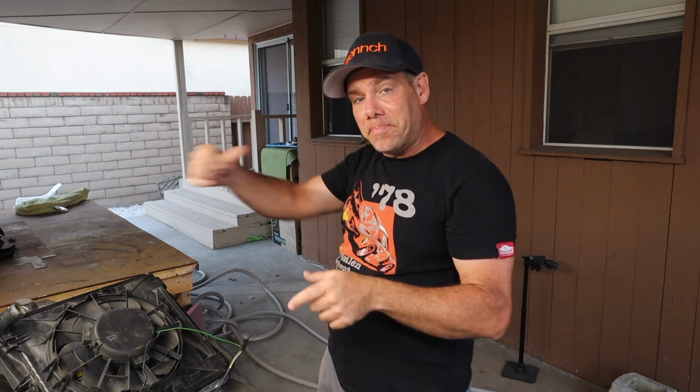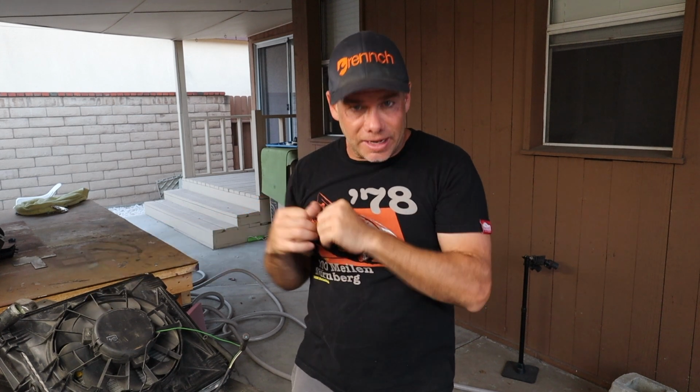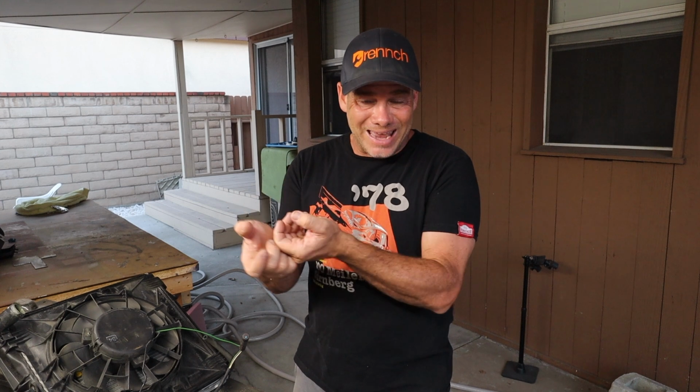Instead of going in through one radiator, all the way through, then to the other radiator, all the way through, and then back, it went out, split, through each radiator, then came back. I'm not sure which is better, but I'm assuming because Porsche did it, it's probably the best way to go. So I've installed these 1-inch tubes now. What I'm going to do is get some aluminum bungs welded on the end, and if I can, I'll show you what the plan is in terms of an AN fitting. Then I'll use hose to split out to each one of the radiators.